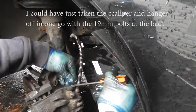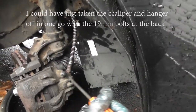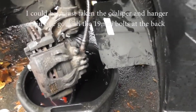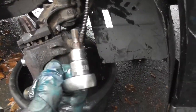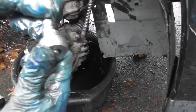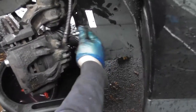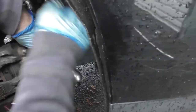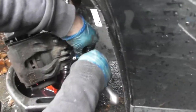So now this is obviously out, we can just get the flathead screwdriver and pop these two little caps off here — there's one, and there's two down here. This is a really good tool. You can use Allen keys, but it's just going to be a pain, so this is easier. 7mm on a 3/8. So let's just chuck it in here and undo it. There we go — there's one, then two.